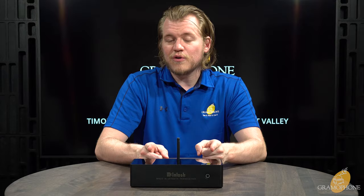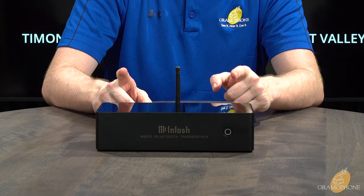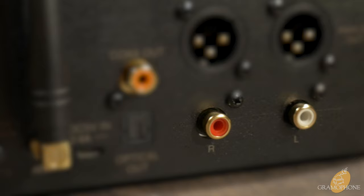This is very special in that it is a Class 1 Bluetooth device. A Class 1 device has a useful range of up to 150 feet versus the traditional Class 2 average of around 30 feet — that is a colossal difference, more than five times the range. This is also a Bluetooth 5.0 device, giving maximum transmission quality. While it's not Bluetooth 5.1, that's less relevant here because this is designed to be a stationary product — 5.1 was designed for devices constantly moving — and as long as your source device is within 150 feet, which covers most homes, you'll have an excellent experience.